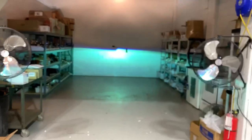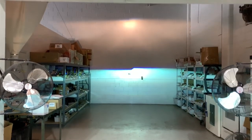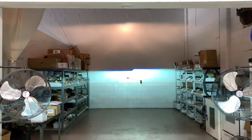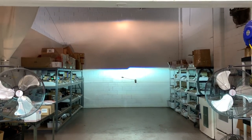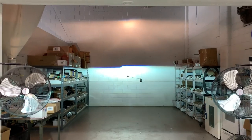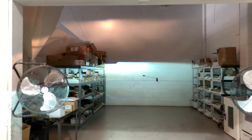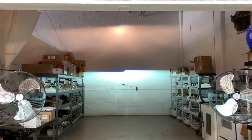The benefit of the HID system — it's warming up right now, so it's going to take maybe 10 seconds or so. You can see the top is the original Silverado projector. It's halogen. It's very centralized as far as the hotspot. Off to the sides, you really have pretty poor performance. The HID system does give you that advantage and it gives you a much larger spread of light, so it's much more usable.